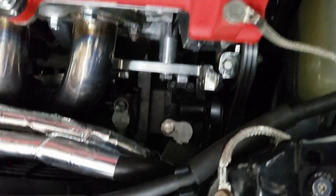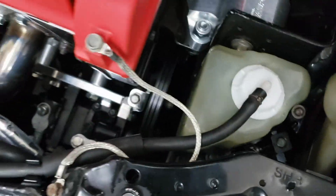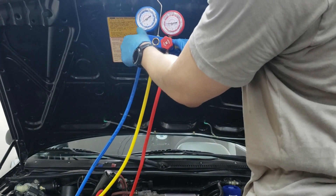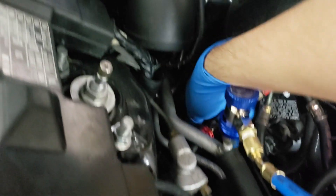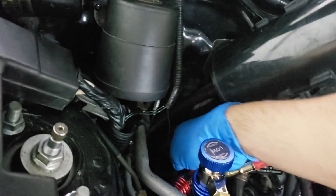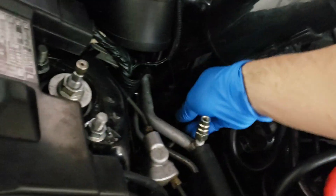There's some weird sound coming from the AC compressor — I have no idea what it is, but we'll wait and look at it after it's all charged up. Seems like the second can is complete. Now we turn this off and close off both the high and low side valves. Those are both closed off and now we can just pop these connectors off and cap them back.